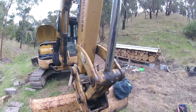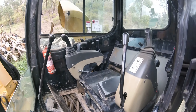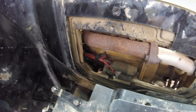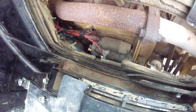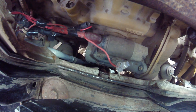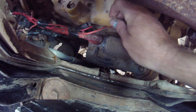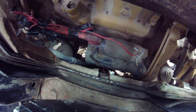Welcome back - another day, the same problem. I'm back here again looking at the starter motor issue. I've just spent a fair bit of time taking off the panel here, and what I actually found as I took that panel off: the red wire with the connector on the end - the white bit of wire sticking out the end - that should be connected onto this wire, onto this connector. What I've found is I've held it in place, turned the key on, and the thing starts up. So this is definitely the problem. I just don't know how I didn't spot this last time, but I'm really glad I've found it now.